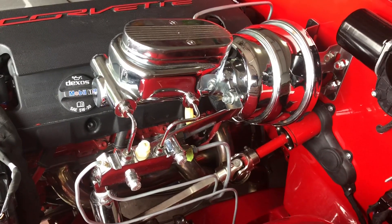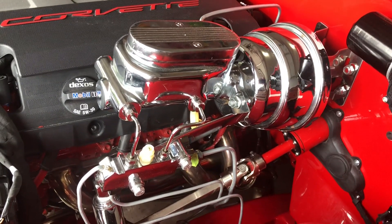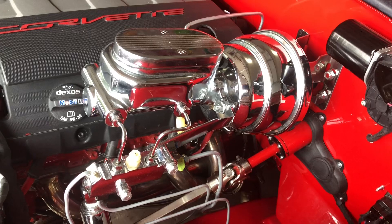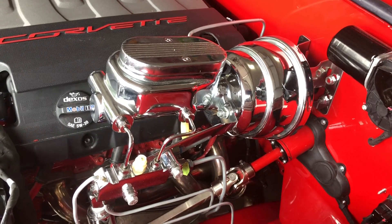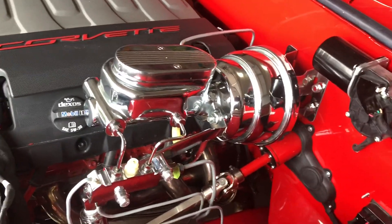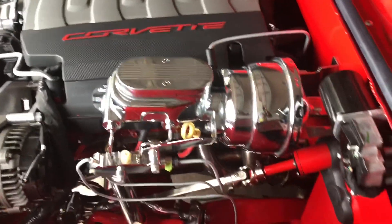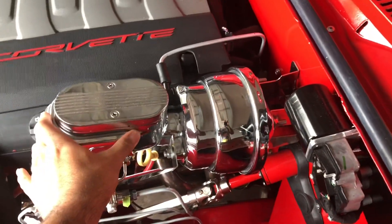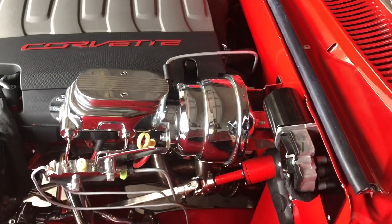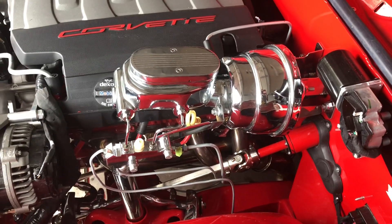What else — these brakes. I have a 100% brand new brake system and they suck. This thing does not brake the way it needs to — it's not stopping good. It stops okay, but that's not going to fly because this car is really heavy and it doesn't even have the hydraulics in yet. I can imagine putting 900 more pounds on this car is just gonna make it worse. This needs to be addressed. The first issue was just a bad master cylinder — brand new, bad out of the box. Swapped it out, worked a little better; I got a pedal now, but man, brakes have definitely been a headache.